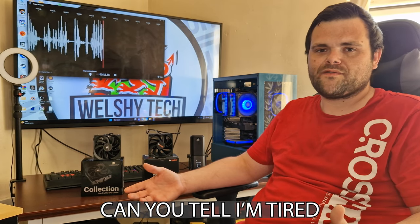So yeah, either one will do, but if you've got a 65 watt TDP CPU, then both of them will be fine. But if you've got anything above, like a 5800X or a 5900X or even a 5800X3D, then the Be Quiet cooler isn't for you. The Thermalright air cooler can handle the 5900X. But of course, it's a low profile air cooler. It's meant for very small form factor builds. But that's just one of them things.